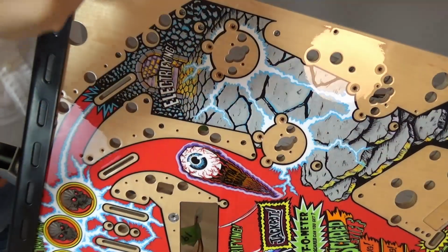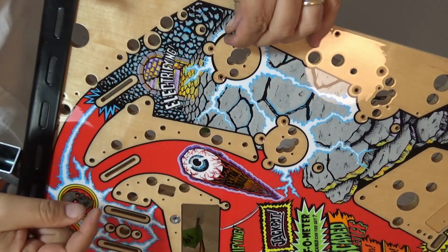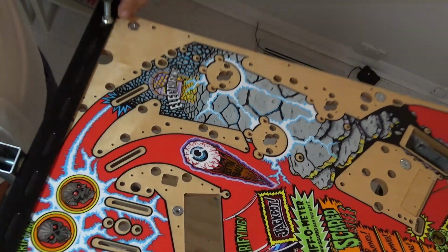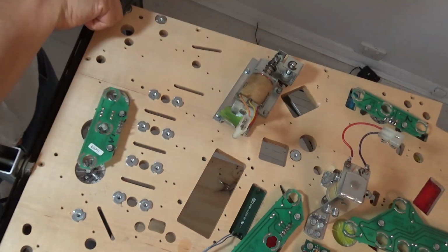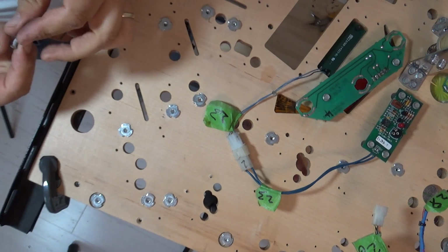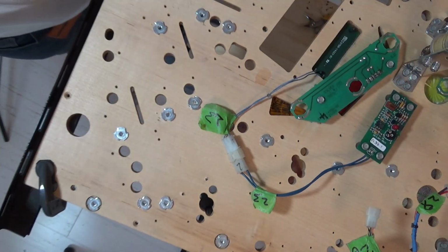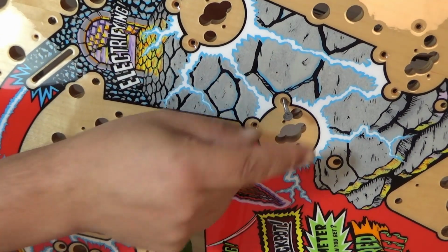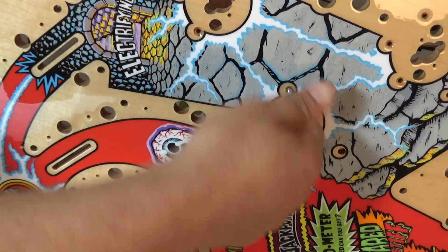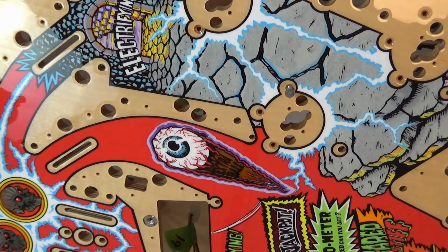Let's go. Okay, so we're now on the new Playfield, and here are the screws that need to go in. Now, there are some videos that suggest you might want to drill these out. I'm going to try one of them without drilling it out. The other thing is that if you look on the other side of the Playfield, where the pop bumpers go, there's also some videos from CPR themselves, so you can maybe drill these out, but those seem quite old. So if I go back to the top, without much force at all, I'm able to just turn these in without having to damage or to drill the hole at the bottom. So I'm going to try one of these. These literally are just turning in with my fingers.